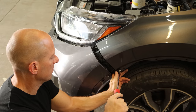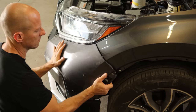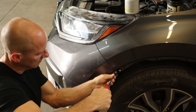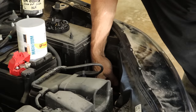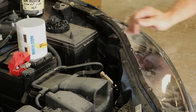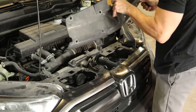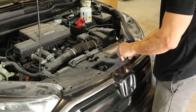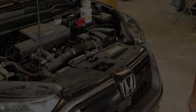Now that we have the rest of our bracket, we put this other screw in, so I might not have any leftover screws with this build. We can clip our bumper in with our bumper installation tool and put our other screw that holds the back of the bumper in. We can plug in our headlight and then clip the harness onto the back of the headlight so it's not dangling in there. We'll push pins in the top of our bumper, and we can put the closeout panel in and put all our push pins in that. Seems like an excessive amount of push pins in that little piece of plastic.